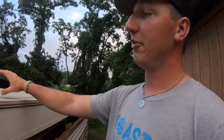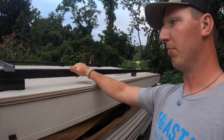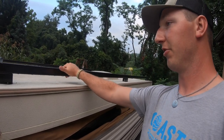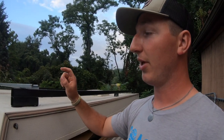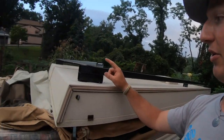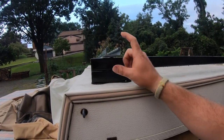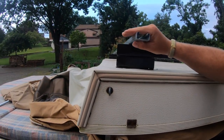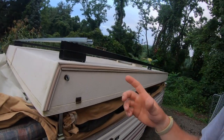One thing that is very important when you're doing this roof rack, I used regular deep strut for the main base of it, just because it's sturdier, it's stronger, it's not going to bend or bow in the middle. But for any roof rack attachment to work, you need to use shallow strut. It's only 5/8 of an inch thick by 1 5/8 across. And any of your clamps should clamp right across them. But I think I'm going to go with it hanging over for now.